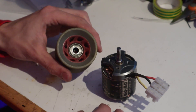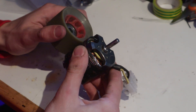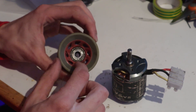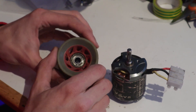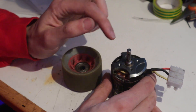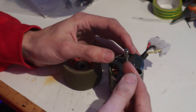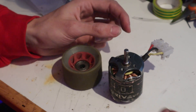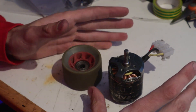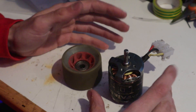My plan is to take this wheel, remove the original plastic hub from it, and basically stick the electric motor in there to replace it. We want to make that a really tight fit so there's no slip between the motor and the wheel cover. We also need to modify the truck on the skateboard so we can attach this motor to it — we might have to grind the shaft off and then make a little motor mount which we can weld onto the skateboard truck. Hopefully we can then fit it all on the skateboard and ride it.